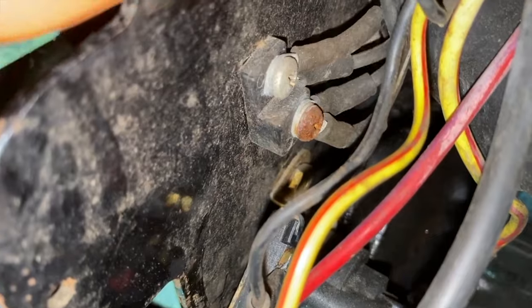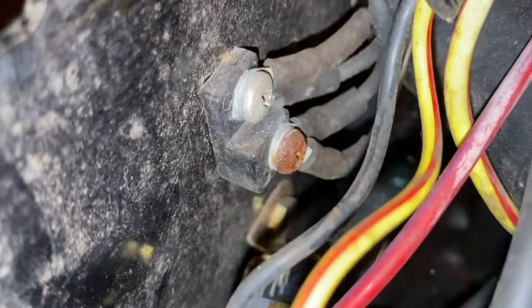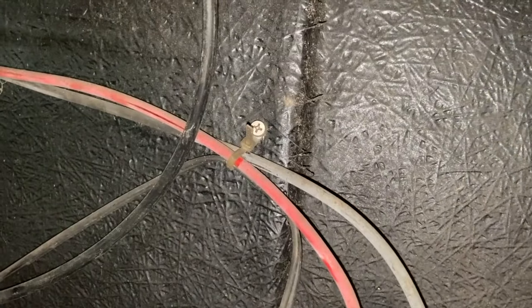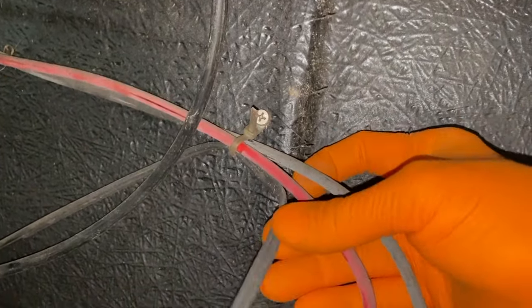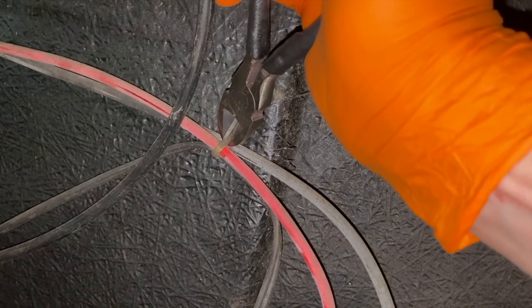I'm pulling the two wires out of the four that are right there. On the other side is the trim hydraulic motor and reservoir and the solenoid wiring. At this point I recommend taking several photos to ensure that when it comes time to re-secure the wiring you know which ones go in. Here is the wiring — be extra careful as you do this, the last thing you want to do is cut a wire.